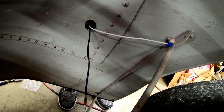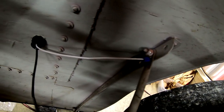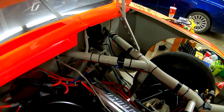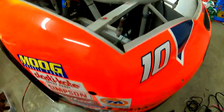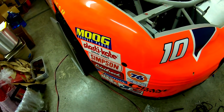I've got this turn signal wired up there. The ground right there is a good ground, and the wire was the perfect length for me to put that connector on there and get it behind that bolt. And then I've got it just zip tied, running down across. I know it's not ideal, but I mean, it's gotta get back up to the... but I think it's super duper low profile. You can barely even notice it's there, which I guess, I don't know that that's a good thing.